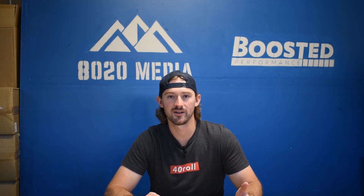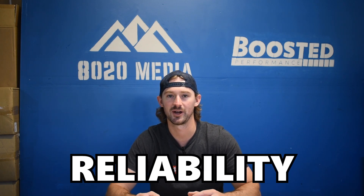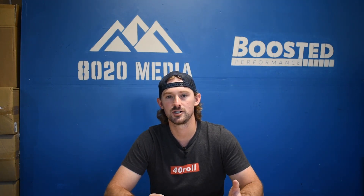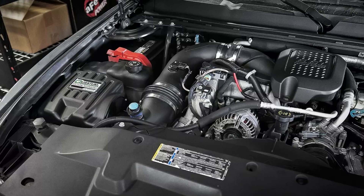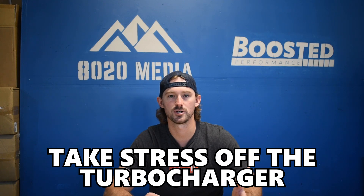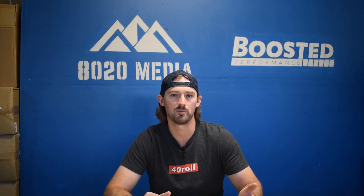With proper tuning you can get a ton of power out of these engines. The rest of the modifications on this list aren't necessarily to add additional power — tuning can get you there. It's more so to optimize the efficiency and reliability of your engine when it's tuned. My first recommendation is a cold air intake. Once you add tuning and you're running higher boost levels, it's really helpful for the turbocharger to bring that additional airflow in. It'll help take some stress off the turbocharger, improve its efficiency, help it run a little bit cooler, improve reliability, and ultimately result in lower EGTs and engine temperatures. While some say you don't need an intake until 500 wheel horsepower plus, there's still some benefit to doing it ahead of time, and you might even get some fuel economy gains out of it as well.